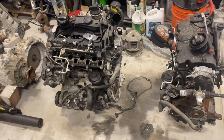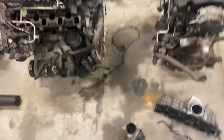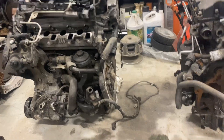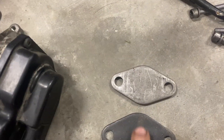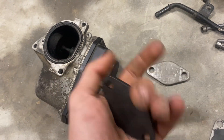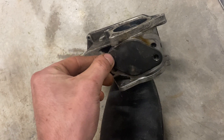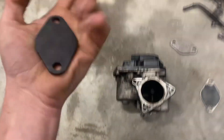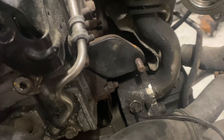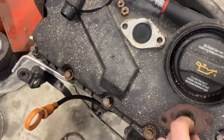For whatever reason — maybe you want to clean up the engine bay, get rid of that pipe, or maybe the flex broke — the next easiest way is strictly blocker plates. The four cylinders really only have two different styles: a narrow one and a longer, fatter one. This one is used on ALH and BEWs and apparently fits on here nicely. You can find these on your favorite online retailers. It also bolts onto your turbo, so that's blocked off and away you go.